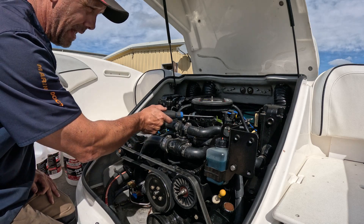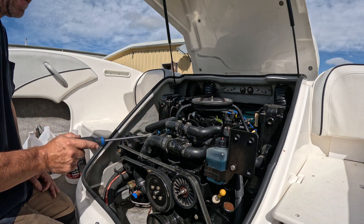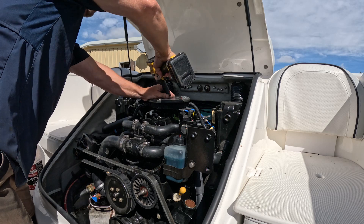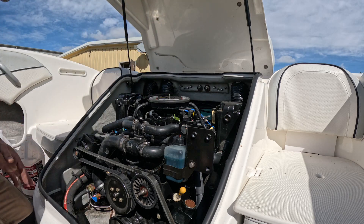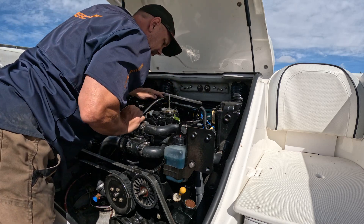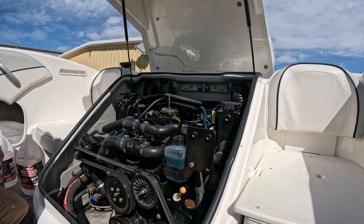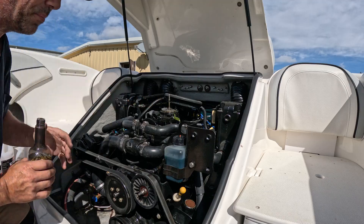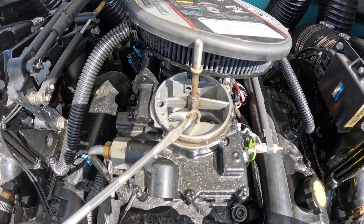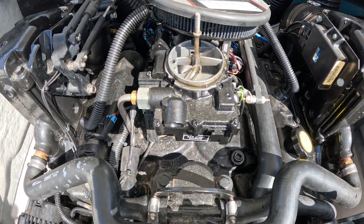Now the next thing is the carburetor. How do we know that carburetor is going to be fine over the winter? We need to get stabilized fuel into this carburetor. We're going to spin this cover off — that's the 7/16th nut, set it aside. Now we have to treat this because the carburetor is open to atmosphere. So how do we get fuel stabilizer in there? We go through where atmosphere goes in — there's a little port right here. All we need to do is put a couple drops of fuel stabilizer in there and that'll treat the fuel.